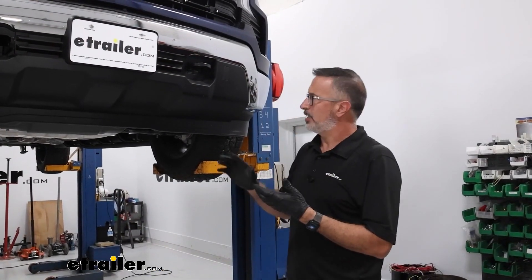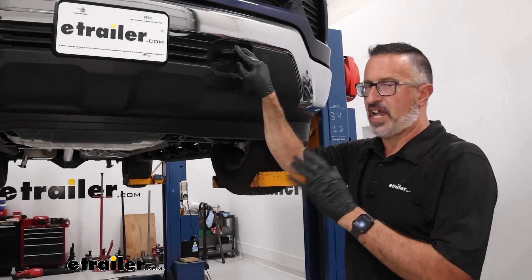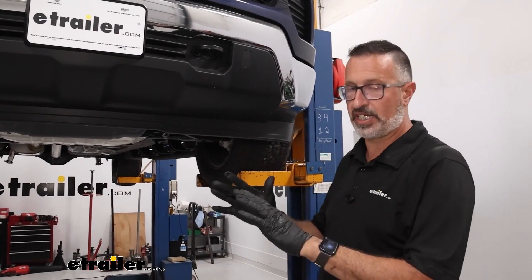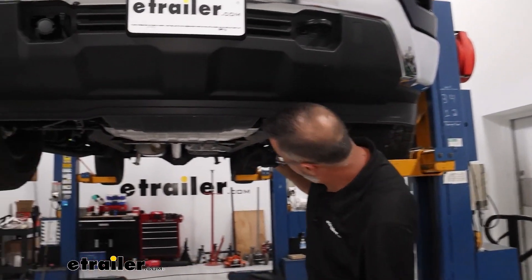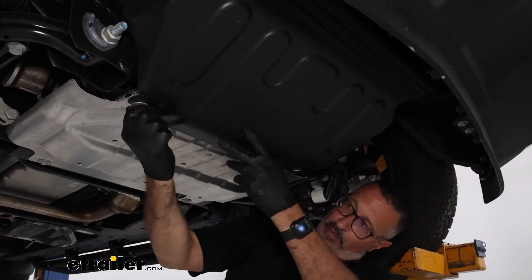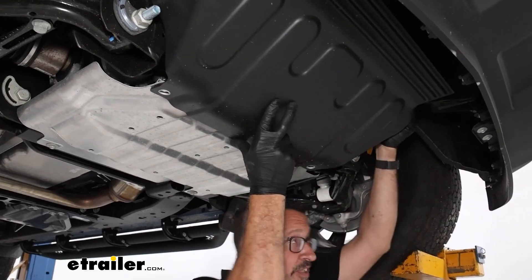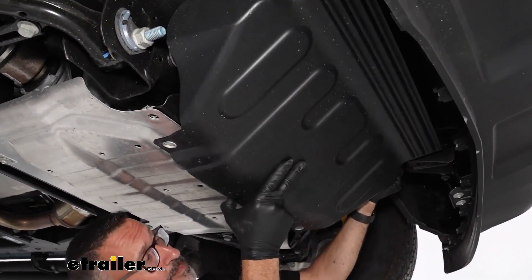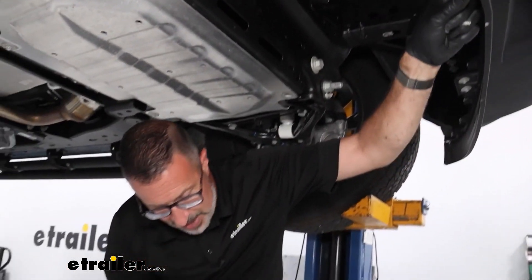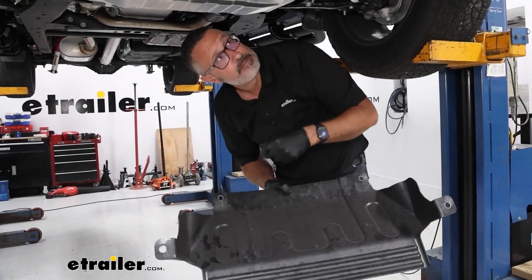To begin our installation, we're going to be coming under the truck. We're going to be removing our factory tow hooks here. Side note: General Motors has been waxing their frames from the factory. You're probably going to want to get some gloves. It looks like grease, but it's just wax and it's going to get everywhere. We'll come up underneath and you're going to have a factory splash guard here. We removed it earlier just for filming purposes and realized that by doing this you have a lot more room to work. It's only four bolts that hold it up. Once you remove it, you can see it's wide open under here. It's not in the instructions, but do yourself a favor and just remove those four bolts to give yourself more working room.